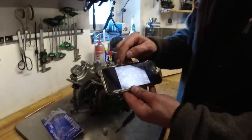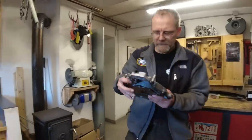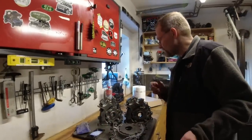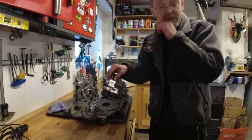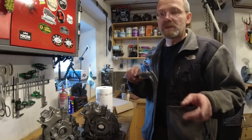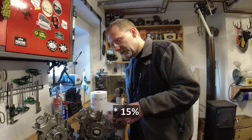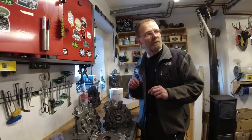Here's the picture we took — you can clearly see a 6600 AE. A weak pump has the casting number AC. You have an AE pump. The problem is that the AE pump, when I measure the thickness of the rotor, it's only a 13 millimeter pump, versus the latest version — like the one we took out of Rainer's Discovery today, which is a 15 millimeter rotor. That's about 10 percent more fluid delivery if you put in a newer pump, which is worthwhile especially if you are doing the timing chain soon.